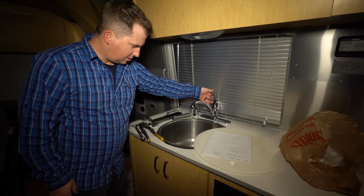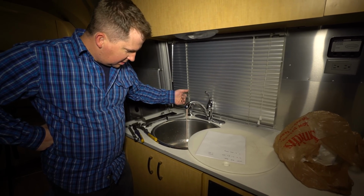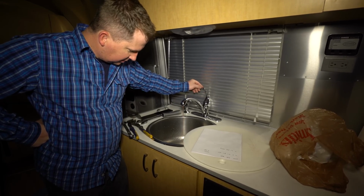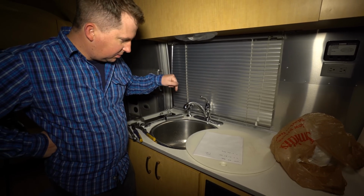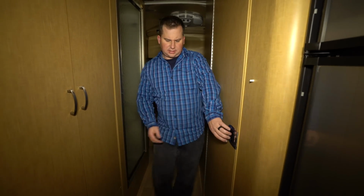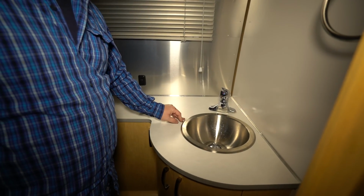Water. So yeah, we thought we drained it all. It's turning pink. This is good. Okay, pink means antifreeze. Okay, we got it through that whole line. Next up, we'll do the shower. You're supposed to start with whatever's highest and then move to lowest. Actually, this is going to be the next lowest thing in here. Okay. I'm going to have you hit that pump again.